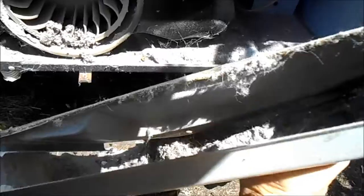Once you get those screws out this part here should come right off. We can see it's not too bad - I'd say it's almost a quarter packed up and we've got a little bit of lint here on the blower wheel.